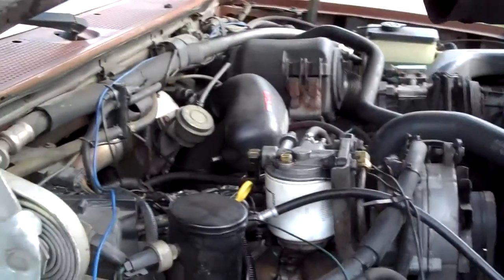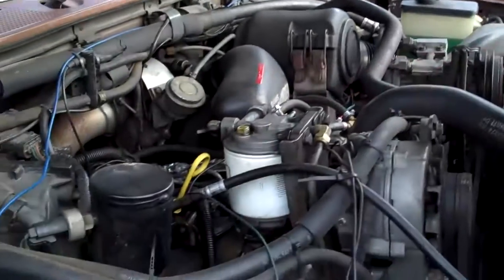You want to make sure that you change the filter soon — don't wait until the truck quits running, because that means you've got to tow it somewhere. And these are a pain to bleed; there's no real easy way to bleed these. When you put your new filter on, fill it up with good, clean, filtered fuel. Just pour that good, clean, filtered fuel into the filter and try not to spill too much of it when you screw it back on. Then start it up and hold it at a high idle to help get rid of the rest of the air in the system. And if you've run it out of fuel or ran it until it quit, well, good luck — you'll need to bleed the fuel system.